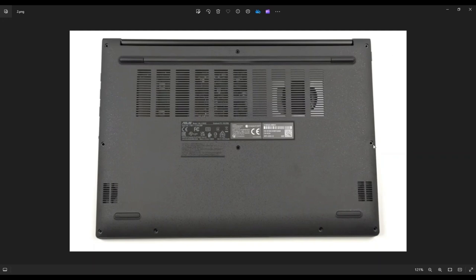After all those screws are removed, you're going to take a small, flat, preferably plastic pry tool. I say plastic because they tend to scratch your cases a little less than metal ones do. You're going to take it and go around the outside edge, the seam between the bottom case and the palm rest, and gently but firmly pry the bottom case off. Don't put the pry tool too far in — you could damage some internal components. Keep it on the edge, and if you get stuck in one place, leave it, go to the other edge, and work your way around. This one wasn't too difficult to take off.